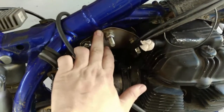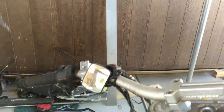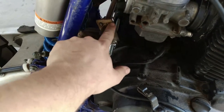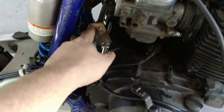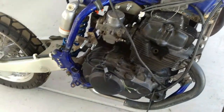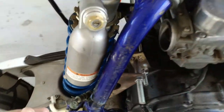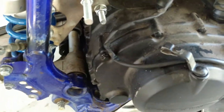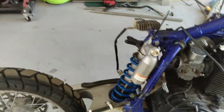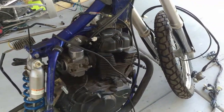We came through and made motor mounts for it. These are going to be rebuilt out of thicker metal - right now they're just to mock it up and hold the engine while we built the rest. When it's welded we're going to come back and grind these down so they're nice and smooth. For those who've pulled an engine out of a WR, the engine actually mounts to the rear swingarm. What we did was get a piece of conduit that fits on it just right to keep the inner race on those bearings from sliding in and out, and it works really well.